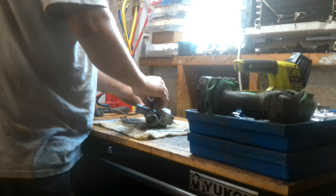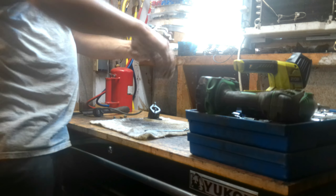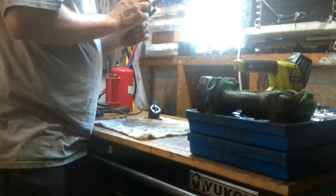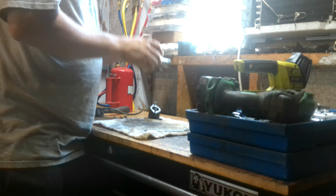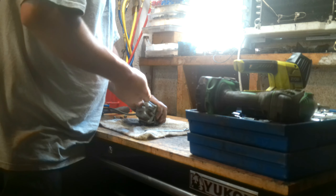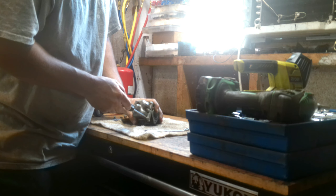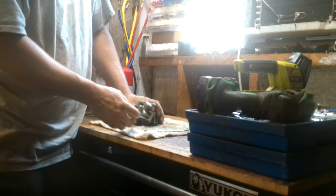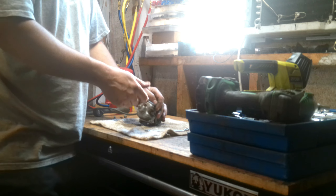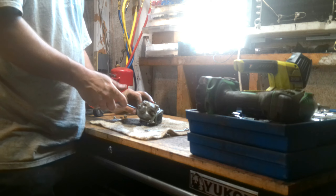I've got the carburetor off on the bench. I did figure out what that random wire was — it was literally hooked to the fuel line on the hose clamp and pulling down because the fuel inlet for this carburetor just pops right out. They had it just holding it to shove that in. That is not okay — we're not going to put it back together that way. Since I have the intake off too, I'm going to pull the other part and just make sure those O-rings are okay. Being the Chinese knockoff carburetor, this thing is going to need all the help it can get running correctly, so a small air leak would still be devastating.